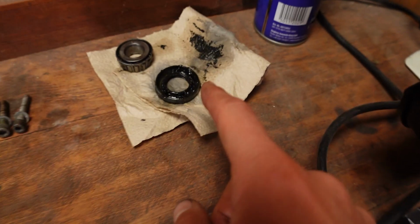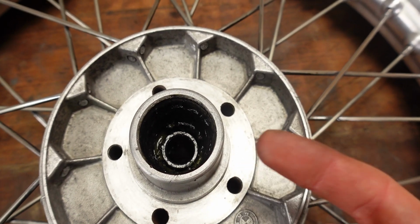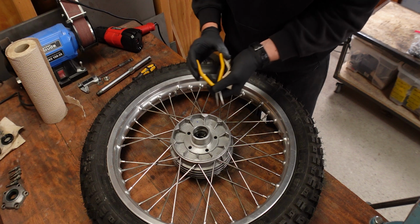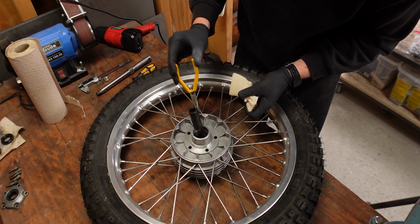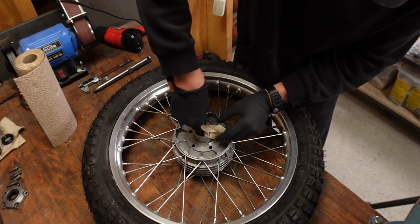So when we now check the front axle, I'm still making the same mistake. On this side, I already have the seal and the bearing out because the Cerakoted axle got stuck and I had to hammer it out, and it took those two pieces with it. There's a sleeve in there as well, so let me see if I can get that out first. Okay, nice. So let's clean this up a bit and give the hub some heat.